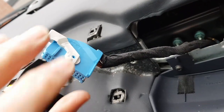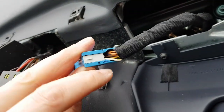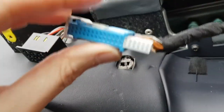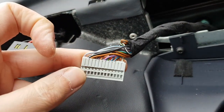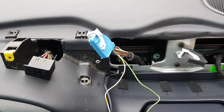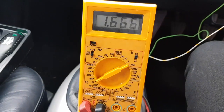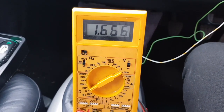I'm going to be doing some measurements on a couple of pins on this blue connector here. To release the connector so I can get the wires out, you need to move this little release lever here and then it will slide out, so now I can get at all the pins. I've attached a couple of temporary wires to the back of connector one — pin 18 for the temperature sensor and pin 24 for the sensor ground. I've got it attached to my multimeter and I'm just checking the resistance of the sensor to make sure it's connected. It's showing 1.666 kilo ohms.